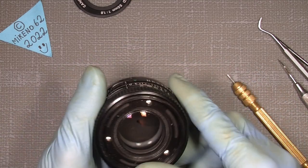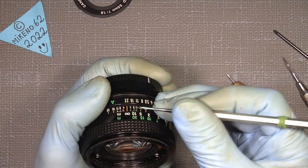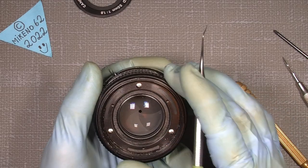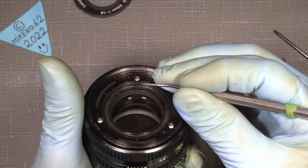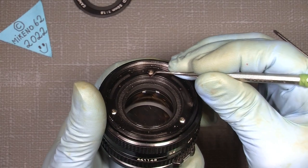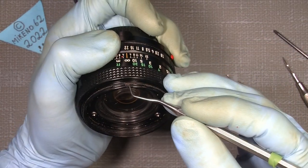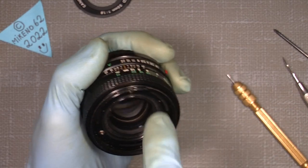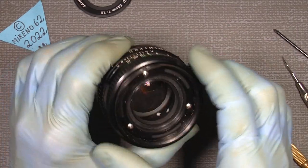See, down under here there are three screws. And just so we have a reference, it's good to have the index mark. That is, in most cases, my reference. So before taking apart anything, I simply make a scratch up here, even on the plastic, which is the mount for the front lens group. We can easily make a scratch here and no one will see it. It has a cutout here, but we can also make a scratch up here. We will go deeper into it and even make more scratches. No one will ever see it, well, unless they take it apart, of course.